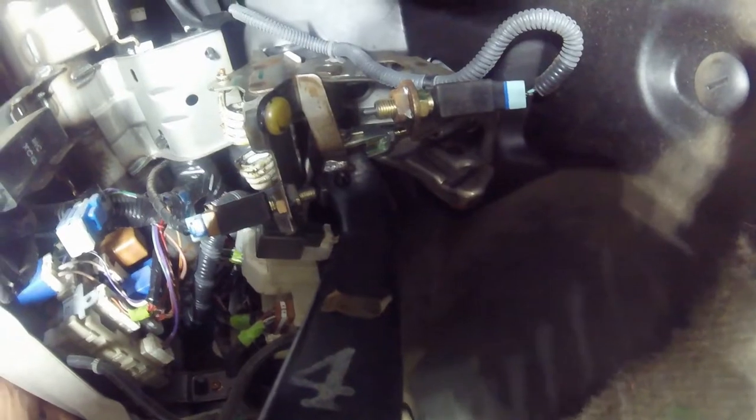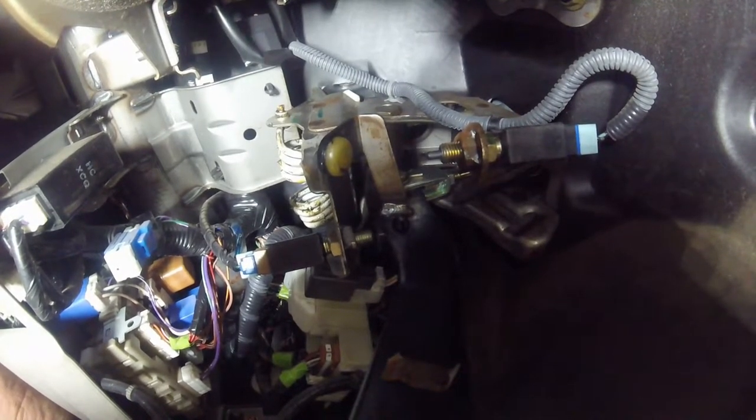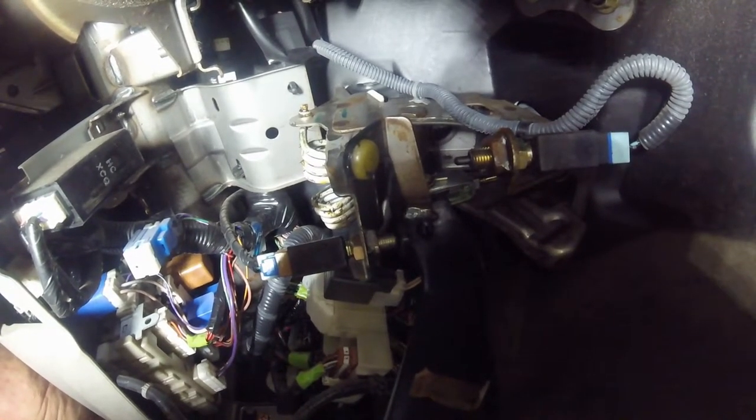Hopefully you can see this. We have to disconnect that cotter pin, pull that out, pull the pin out. Then I shall be able to disconnect the clutch master cylinder. I can't film me doing it purely because I'm going to be doing it blind and I need both my hands. Alright — this is the pin and cotter removed. And if we look up here you can see it is now disconnected. Now I can finish unbolting in the engine compartment and get it out of the way.